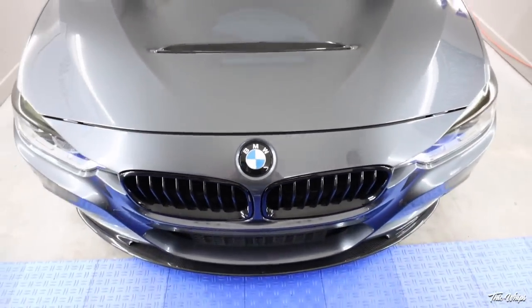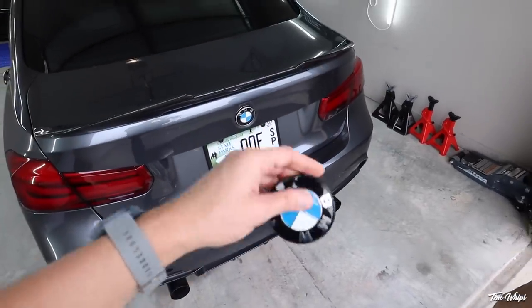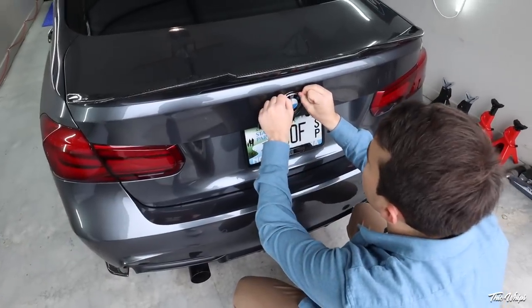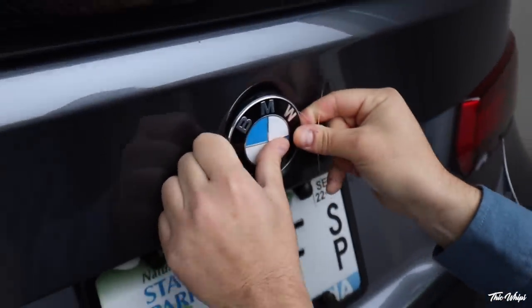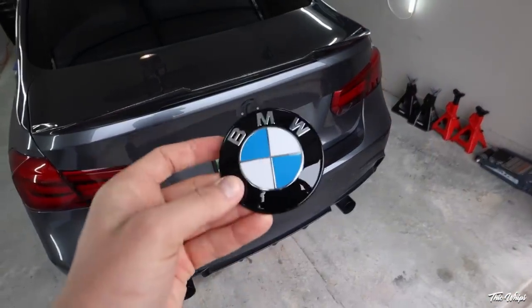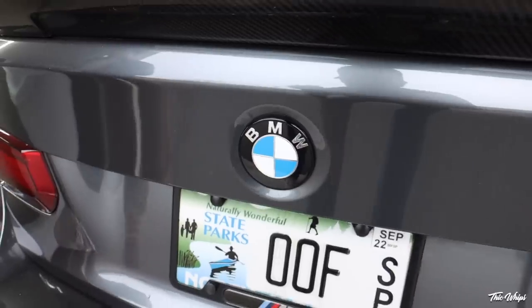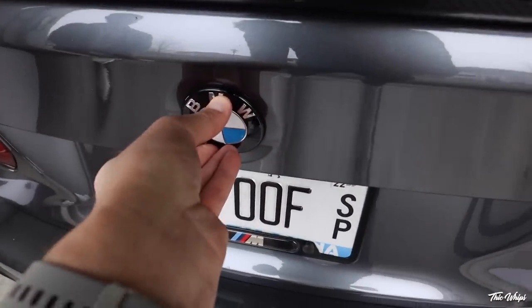The back is a little bit easier — you just have these two little plastic pins. Your OEM factory one shouldn't have adhesive on it, but it might depending on who put it on last. If BMW did it, it's not going to have adhesive and it's actually really easy to take off. We'll use a little bit of fishing line, tuck it behind there, pull out and it's just going to come right off. If you need a little more leverage you can use a trim tool. Now just go ahead and literally take the new one, line it up with these holes — bam, and bam — and just slide it in. It should be super snug. If you want to put adhesive on it you can, but I don't think it's necessary — once you have it on, it's not going anywhere.